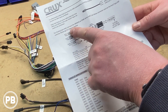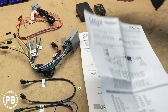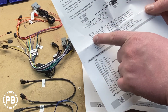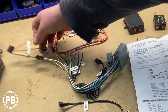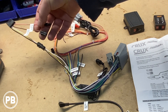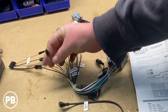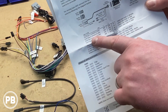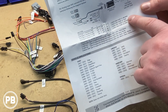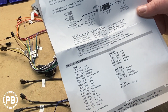For analog type steering wheel controls, connect the brown or the pink wire. If you're using the analog version — which is the smaller module — pay close attention to determine which analog version you have, whether it's analog A or analog B. On the harness adapter, there are two little pigtails that come off, and depending on whether you have the pink version or the brown version, you'll connect to that wire. The instructions have a breakdown so depending on your vehicle, type one through type four indicates which port and wire to connect to and which dip switch configuration is needed, just for the analog side.